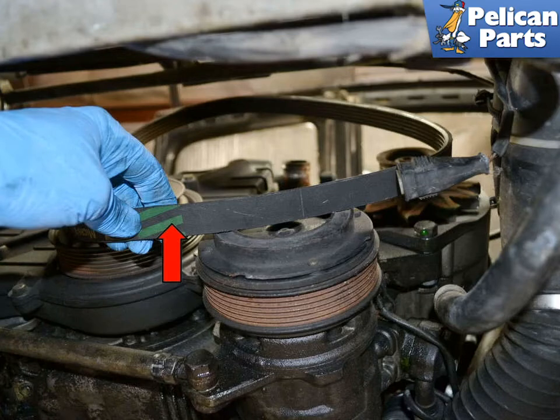If there is not enough room to remove the belt, you can disconnect the turnbuckle from the AC mount and slip the belt off. Installation is the reverse of removal. Tension is set when there is a quarter inch deflection at the longest point in the belt.